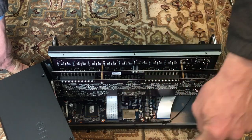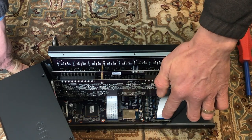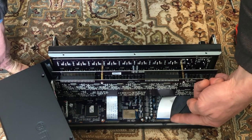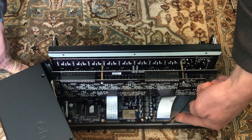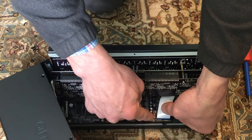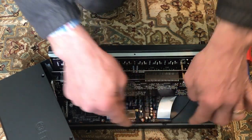There's one here and one here. I think this was my problem — one was loose. Since I was in there, I went and reseated both of them. There's a little black plastic connector with two tabs that holds the ribbon connector in, so you can lift up on that, make sure the ribbon connector is seated fully, and then push it back down so that it's tight.